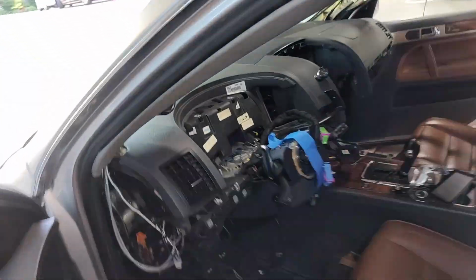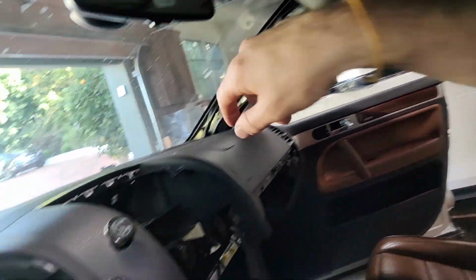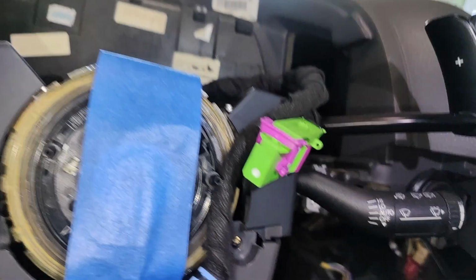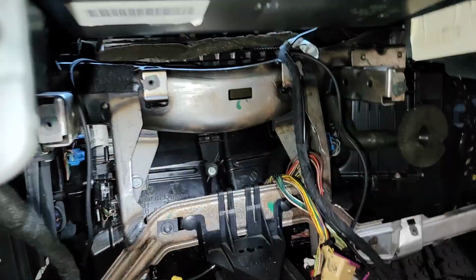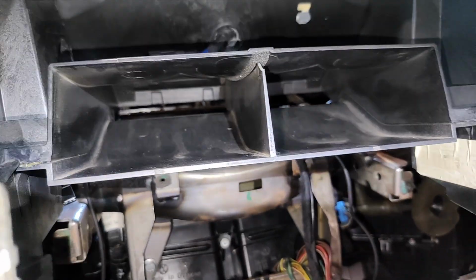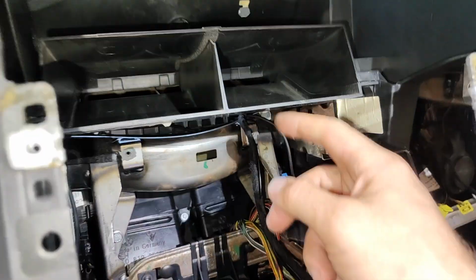With that time lapse, I actually had a trim piece that I had a little wedge in. There's a pin back over in that corner that was being blocked by this, so I took that one pillar screw off, and now you can see that we have full access to this. Now I'm not actually going to take it out. My goal, if I can get enough cable length here, is to re-insulate the heater box and all that foam. You can see all that foam stuff right there in the back. All that's kind of disintegrated, and you can really see it through here way in the back. I'm going to be putting new foam strips on this so that this whole dash can seat properly, and we'll just get some insulation strips in there.